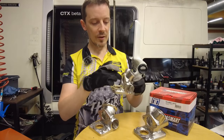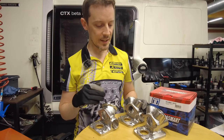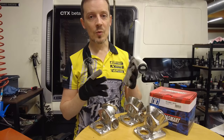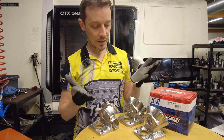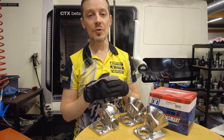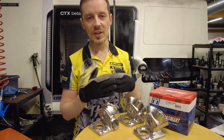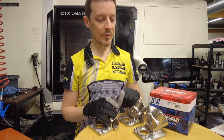This cutout here fits the TurboSmart WG38 wastegate, and that runs really well with temperature consistency. We don't have any type of temperature or wear-related issues beyond what you'd normally see with our billet merge collectors on racing manifolds.